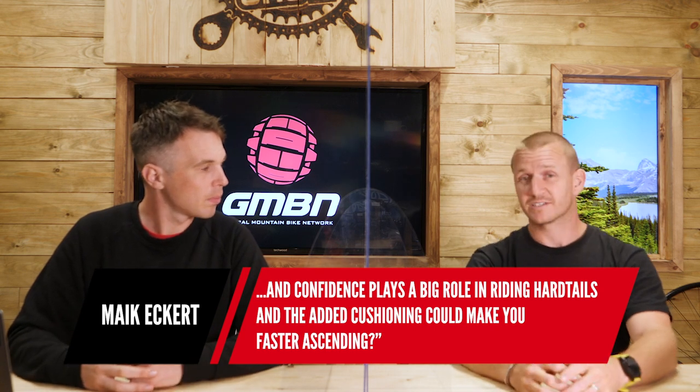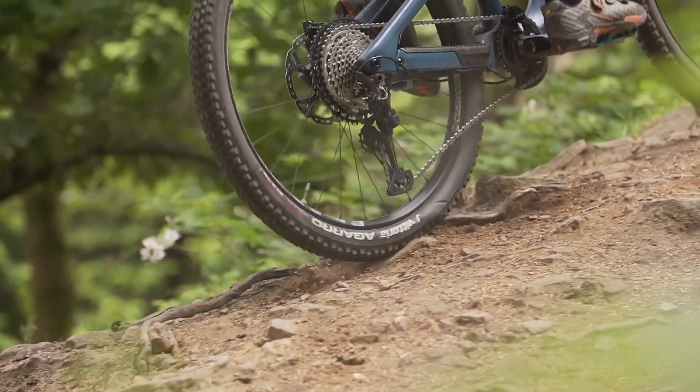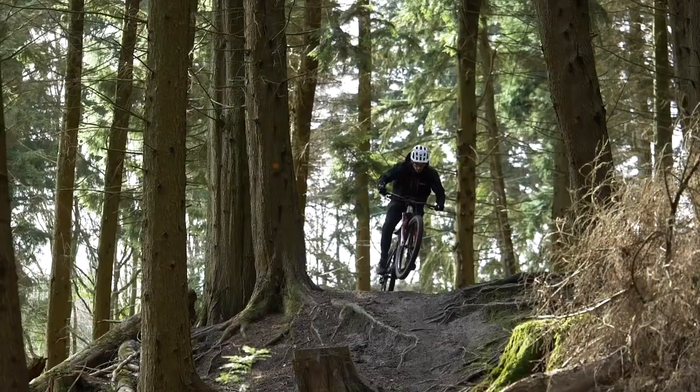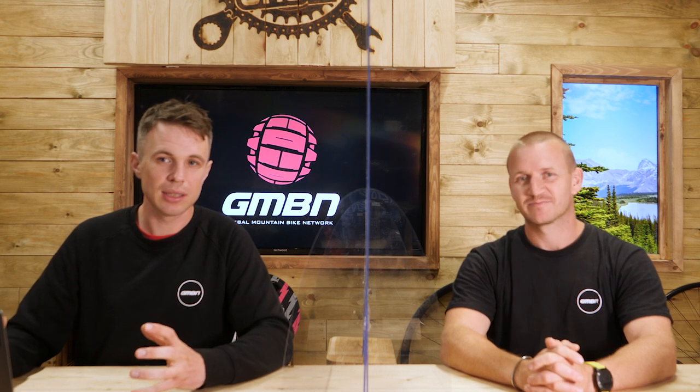I love a hardtail. I do go for a very wide tire on a hardtail, only because you get that extra cushioning at the rear — like he's saying. I'd run both front and rear wide, but on the front I do run a wider tire on my trail bike to get extra grip, and on the rear it's more fast-rolling. More grip on the front because you're doing a lot more steering there than the rear — the rear is just going to step out. The demands on the front wheel are very large: huge braking forces, turning forces, and cornering forces. As riders, we tend to favor a bike that oversteers, which is a lot more comfortable to wrestle than a bike that understeers and won't turn. Front wheel grip is key. There's no reason you can't have your cake and eat it too — the comfort of a big tire on the back, and grip on the front.